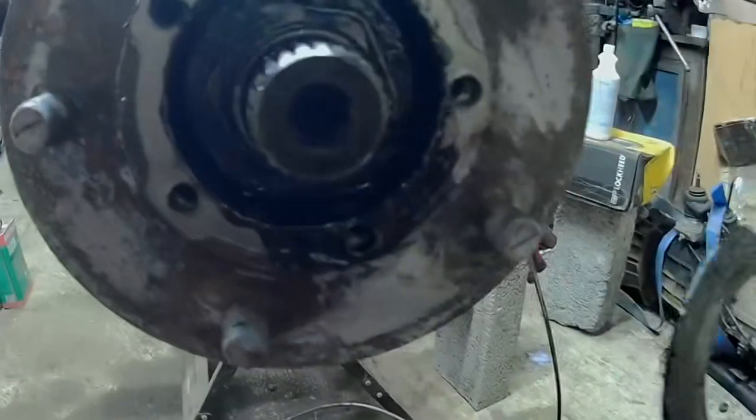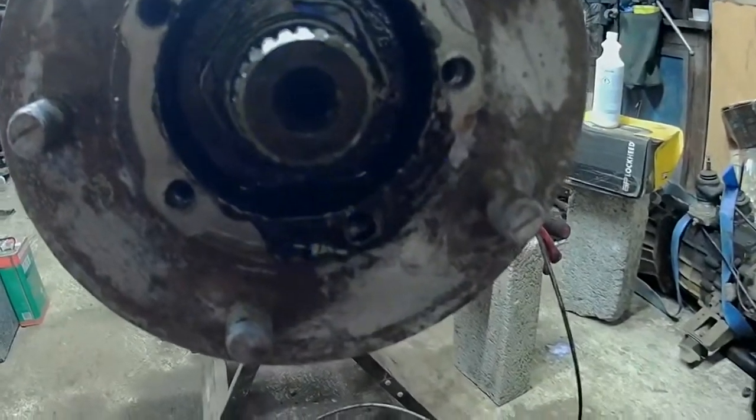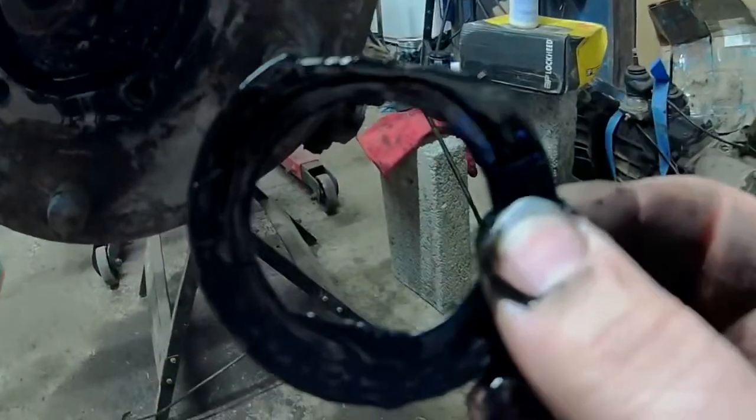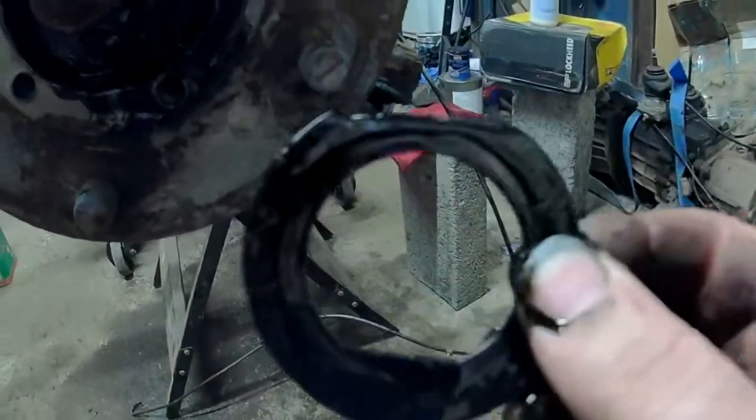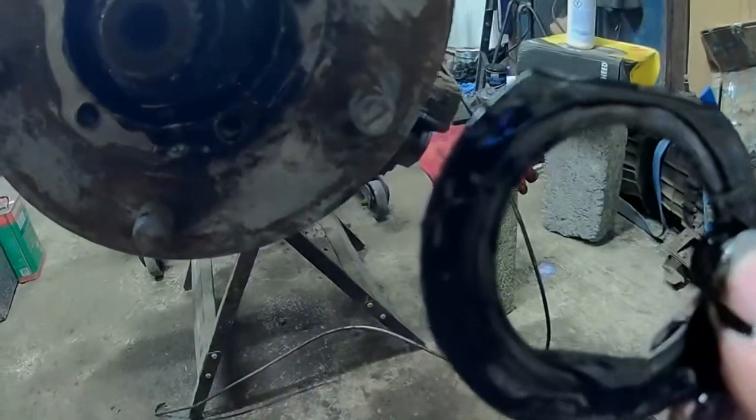I should be bending this flat again before I reuse it. And just bending a different bit up and down next time from the bits that are already bent on it. They are reusable a couple of times, as long as you use a different bit. If you try and rebend a bit that's already bent, it will just snap off and won't do its job.